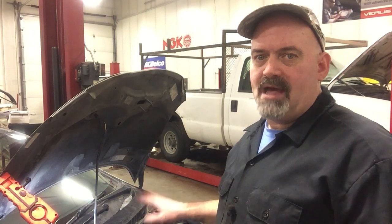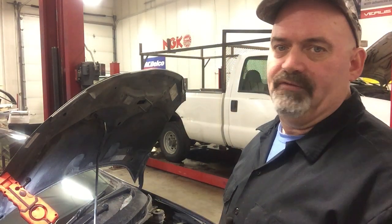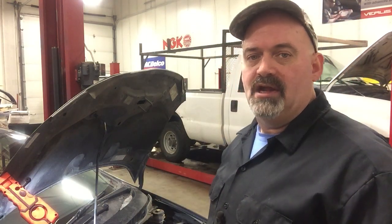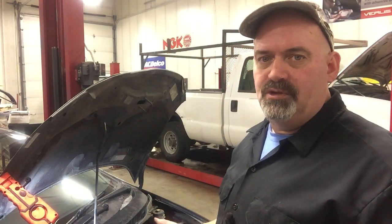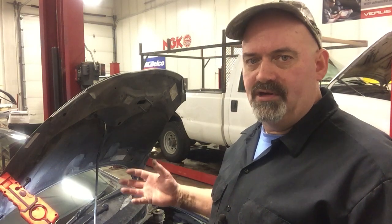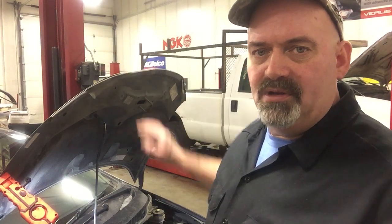Okay, now just a matter of refilling the system. I'm going to use my airlift tool for that. I've got a video, I'll put a link in the description for the use of the airlift system, or just refill it. You just want to make sure you run it for a bit, don't overheat it, make sure it burps out, and you get it properly filled.